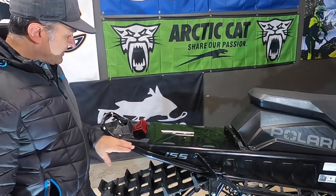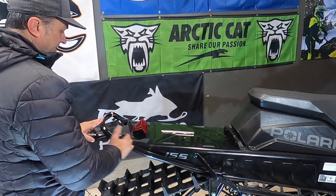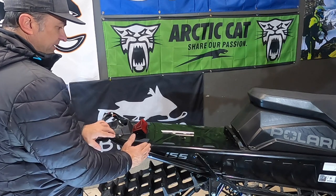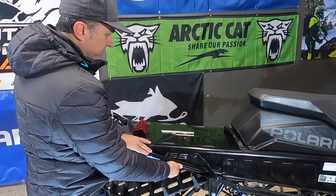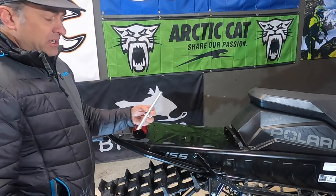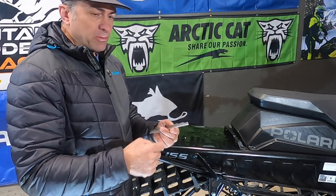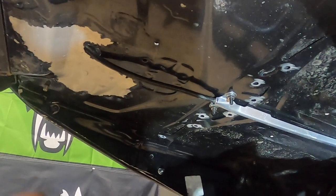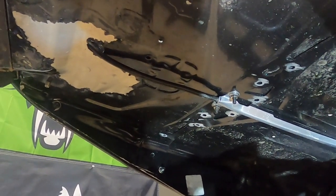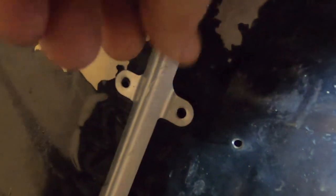We have our tunnel extension in place with just our stock bumper sitting here — it actually fits really well. We didn't change anything from the start of the tunnel extension back, so all the screws that hold your stock bumper on from here back — those holes fit. The holes that mount the bumper on from here down, you're going to have to re-drill those to put your screws in to screw your bumper on. The other thing: there's a little piece that goes from here back in the tail extension to cover our brake light wiring. I shortened this a little bit. Under here you can see my temporary screws holding this in place — I want everything where I want it before I go back and rivet everything down. You slide that in there like that, line up your holes, and rivet this back in place. That's how we get our wiring back where it's supposed to be.